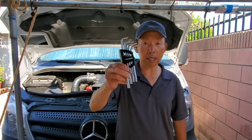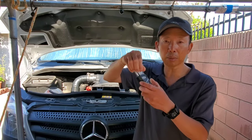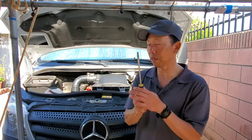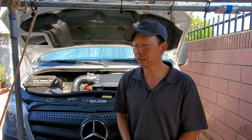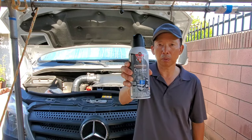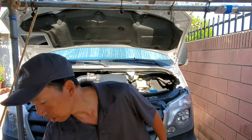Tools you need: a set of Allen wrenches, and these two screws right here — they are T25 and T20 — you need those to take it off. You'll also need a flathead screwdriver to take this ring off right here. If you don't have a duster, it works by blowing with your mouth to try to clean it inside, but if you have a duster that would be a lot of help. That's all you need.